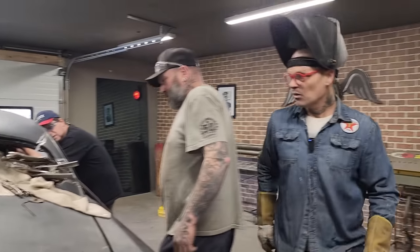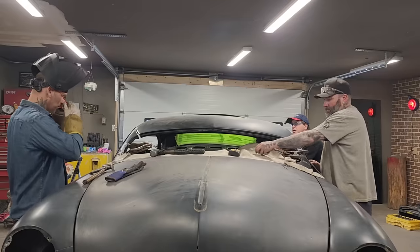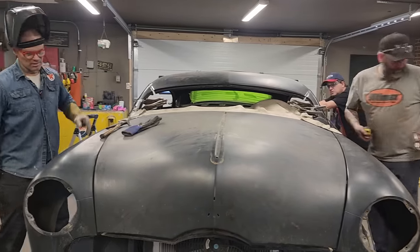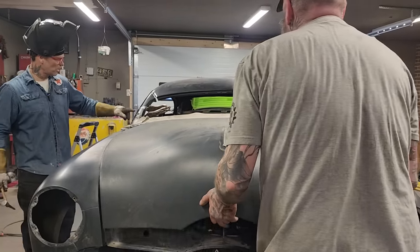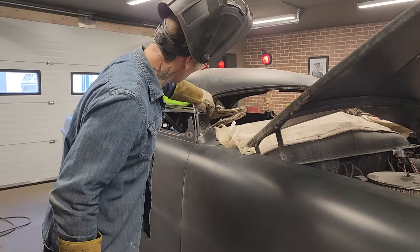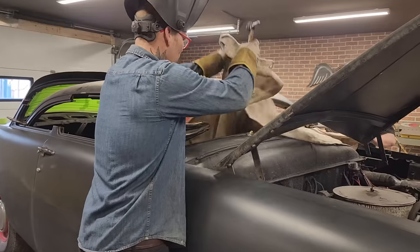What we need to do is pull the hood up. It's twisted, right? If we can, we'll twist that before we weld it. Let's take this out, and then we'll do a measurement from here up to the window. The basic thing we're thinking is the window part. We got the roof on as straight as it can be because we got the back tied in each place, and we got the front pinch weld tied into place. We're looking at the gap from here to the edge of that post to see that both posts are the same amount. That's basically what we're looking for.